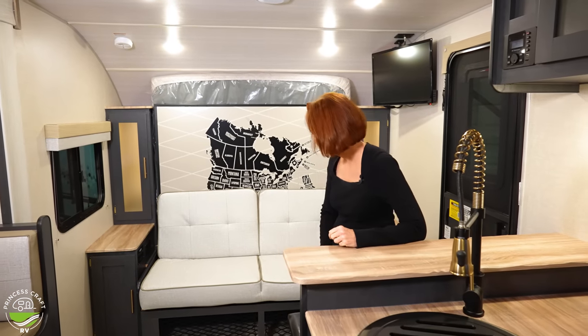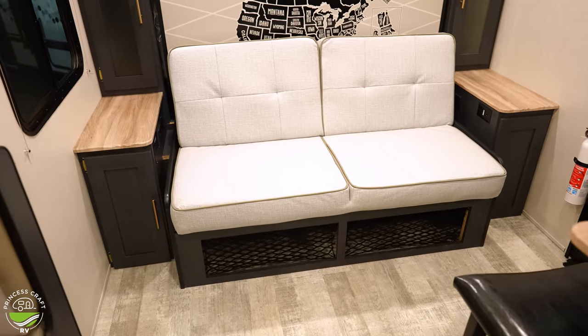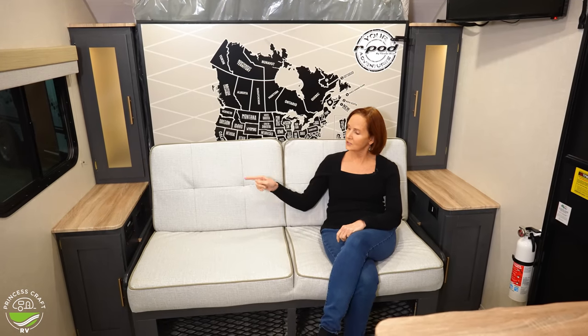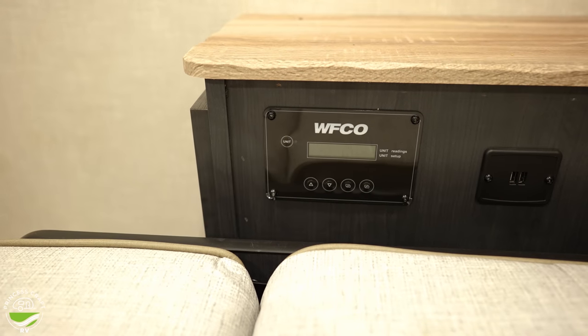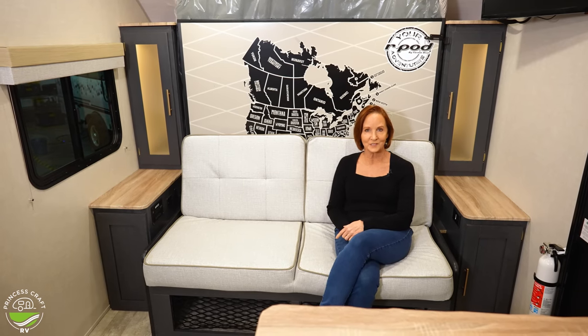First, let's check out the sofa. The seating here is really quite comfortable — it feels very foamy, kind of like a Tempur-Pedic mattress. I like that there are no arms, so it's very open and easy to put up and down. You have side tables on both sides — a 110 plug on one side, 12-volt on the other — and you'll notice there's also a Wifco monitor panel. That is for the inverter. One of the options you can get on an R-Pod is a 110-watt solar panel on the roof and a 1,000-watt inverter. That inverter takes battery power and turns it into a standard 110 plug so you can run regular household items, though at 1,000 watts you'll want to be careful — it won't run your air conditioner or microwave, but it will run some small appliances.